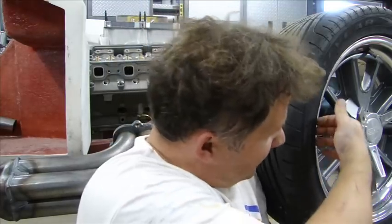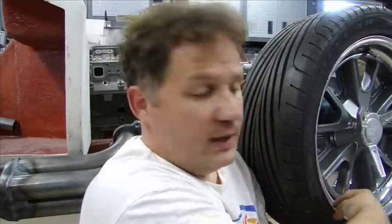When you go to buy your tires, the first thing you want to do is look at the bead. Put your hand inside the bead and rub all the way around. When the tire is in the mold, if it shifts or doesn't go in straight, the rubber will flow in different directions and there won't be enough rubber to fill the bead area — this is called a hollow bead. Run your hand around the entire inside bead diameter and make sure it's even thickness all the way around. If you feel a dip or waviness anywhere, do not buy that tire. There's not enough rubber in the bead area and it won't be strong enough — possibly when you go around a curb it could blow out.